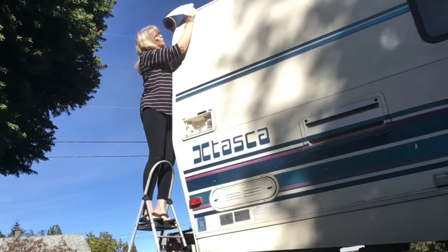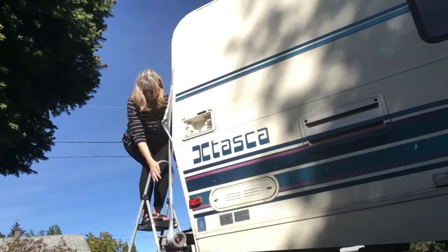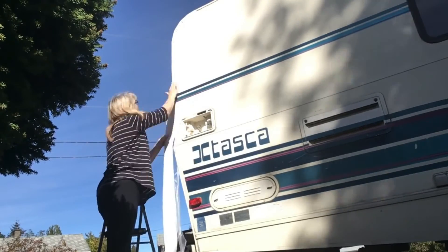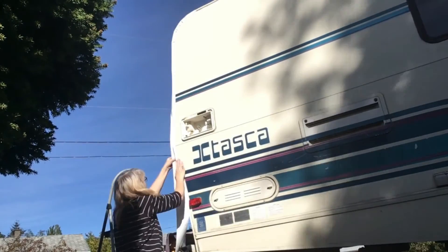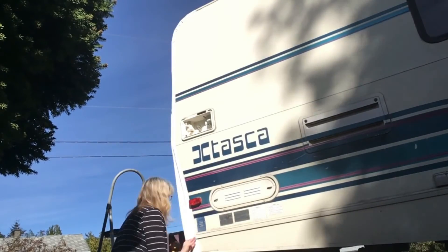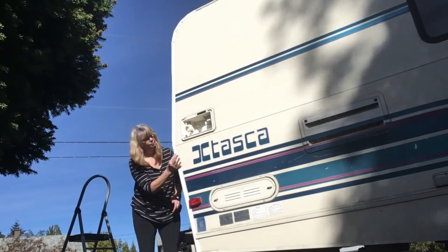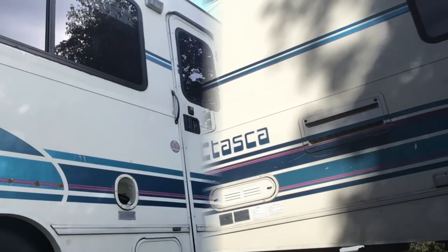The corners were a bit of a challenge. It was difficult to get it to mold smoothly around the curves. If you have an RV with no curves or angles to go over you'll make a much neater job of it than I did. Because Eterna Bond is so sticky it is not very forgiving. My curved seams puckered and I had to try to space the puckers out, which was difficult as the adhesive does not give at all.